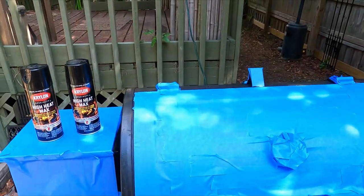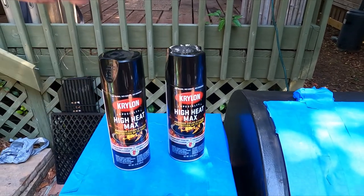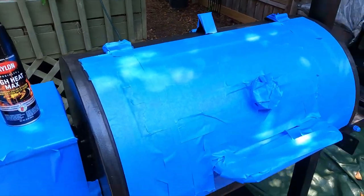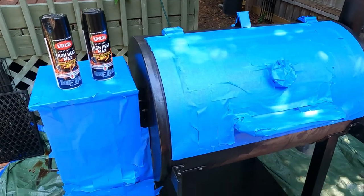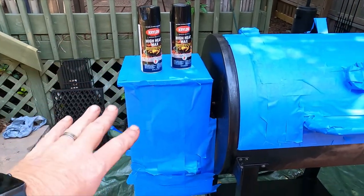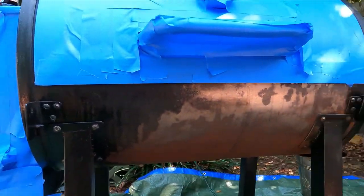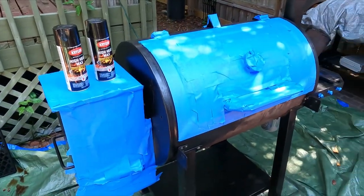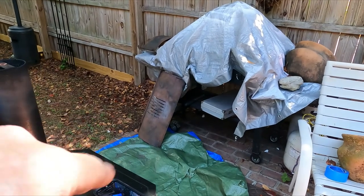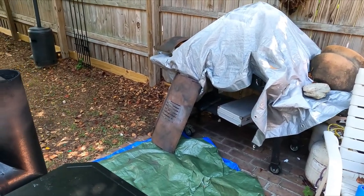The paint that Pit Boss told me to get was the Krylon High Heat Max. They said in satin — I couldn't find a satin or gloss, so this is all anybody had in stock: the Krylon High Heat Max specialty paint. This goes up to 1,100 degrees. Nobody had the copper or the bronze paint in stock — I'll post the links for those colors in the description below. We're not going to paint the hopper since it's in good shape. I went ahead and taped up the entire lid so we don't get overspray on it. You can just see how much better this is already looking. Everything is scraped, dried, and ready to paint. I haven't decided yet if I'm going to paint the heat shield — I know they didn't come painted to begin with, but I do want to do something to it.